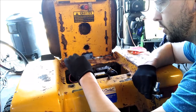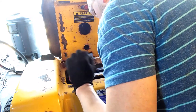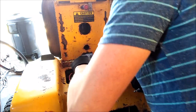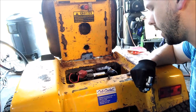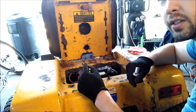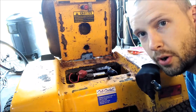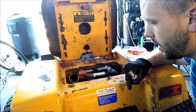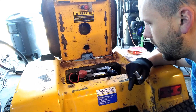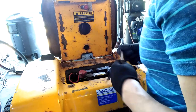Always very much respect the hot wire — the hot wire is the plus side on the battery. If you were to connect the hot wire to any piece of metal on the lawnmower, you're going to create sparks and a short, which could make your wrench really hot, and worst case scenario you could blow your battery up.